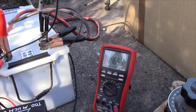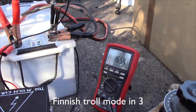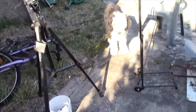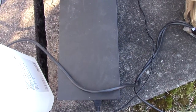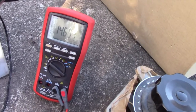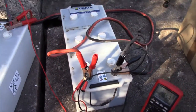The batteries have been charging for about two hours now at around 20 amps. I had to adjust it a few times because the transformer in this thing gets pretty hot, but we're at 14.65 volts. I'm going to do a controlled overcharge - I added a bit of water so they should be all right.